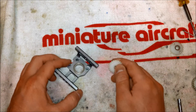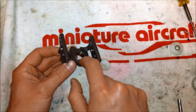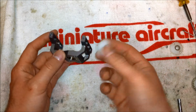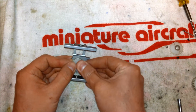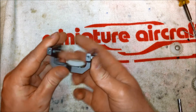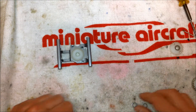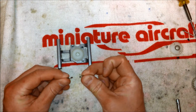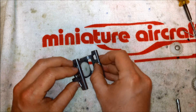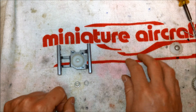Okay guys, we're going to begin the reassembly process. The first thing you want to do is check and make sure that your bearings are fully seated in the front transmission case — especially this one. You want to make sure this one is flush with the surface or it will affect your gear mesh. Once we've done that, you can go ahead and pop in your gear, make sure it's fully seated and spins nice and freely. Once we've got that installed, take a look at the two shims. There's a thick and a thin one — the thicker one goes behind the spur gear and the thinner one goes behind the bevel gear. Don't mix those up.